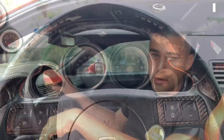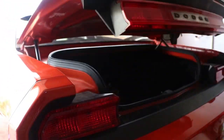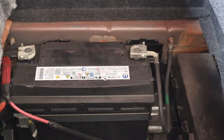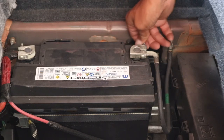This install is for your pre-2015 Challenger. If you have a steering wheel without the LED display, you can follow this video and just skip that step. The first step is to open the trunk and locate the battery underneath your trunk mat. Disconnect the negative battery cable and wait about 30 minutes for all modules to power down.